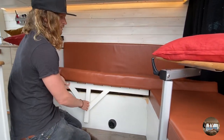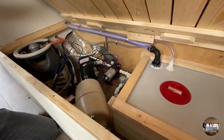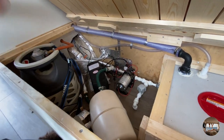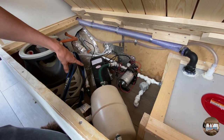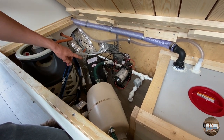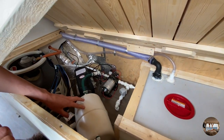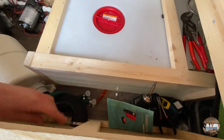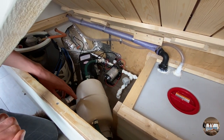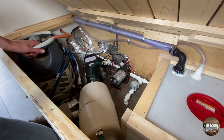I'm gonna show you some stuff underneath the bed-couch. We have the water tank here — 80 liters — we have the pump there, the heater there, and also a hot water heater. When the Chinese diesel heater is warming up it heats up the water inside here — about 5 liters — and then it goes through and into the living room. So it heats up both the air and the water you use in the van. You can also hook this up to 230 volts, and we also have the propane for cooking.